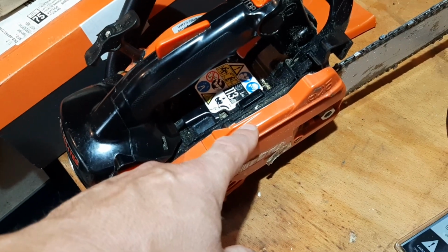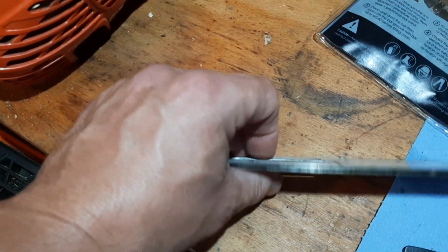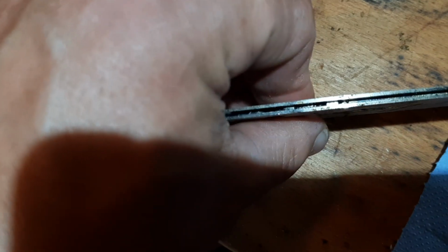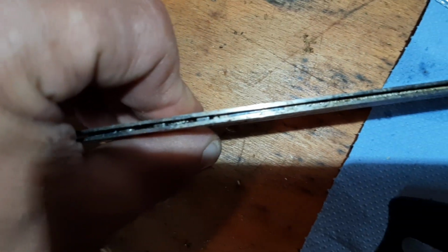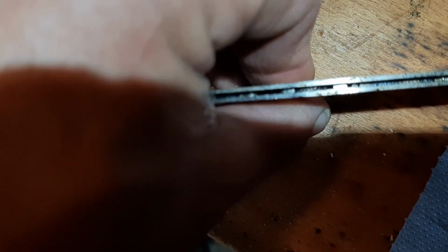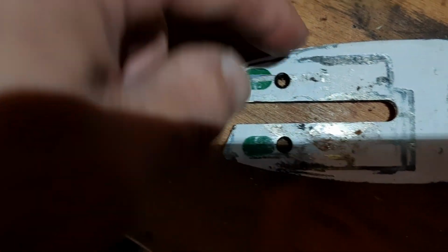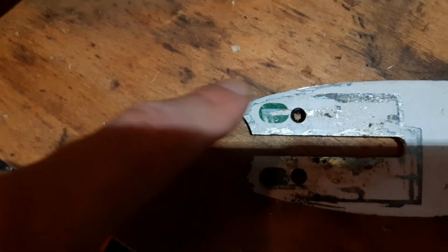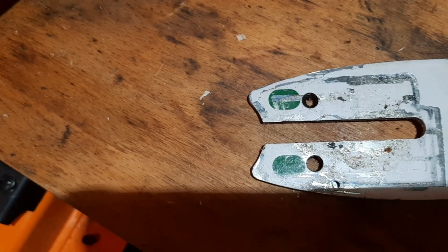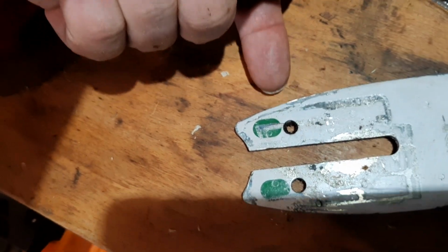their tensioning holes. So the only thing I did was take a very narrow drill bit, chuck it in my drill, and drill a hole straight through the guide bar top, right there, from above right up into that hole. And that's all you need to do. Just a small hole. I believe I took a 1 millimeter wide drill bit and I just drilled it straight through the bar a couple of times like this, and that's enough.